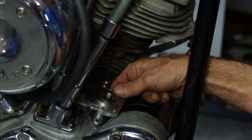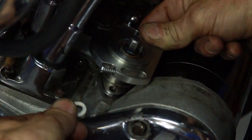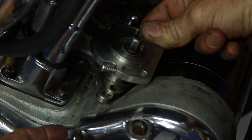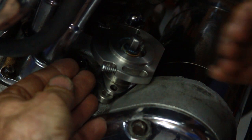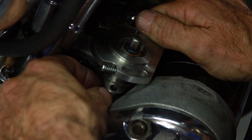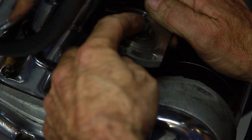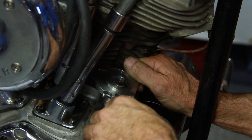Now what we want to do is match the drive, so we want the flat aimed toward the slot. Now in the kit you'll notice there's a spacer. The spacer goes between the bolt-down tab and the motor. The purpose of that spacer is that when it's removed, the drive can come lower, so the magneto goes in and the drive connects up to the magneto — it makes it easier to clear everything. So with that in mind, we're now going to pull the drive out to line up the hex. From the time that the gear engages and this begins to turn, until you get down to the height of the spacer, it's about one flat. So we'll start out with one flat, and around the time the O-ring drops in, that's when the gear engages.